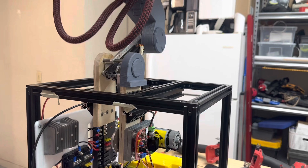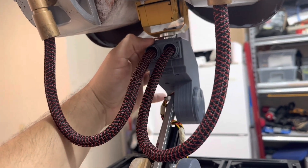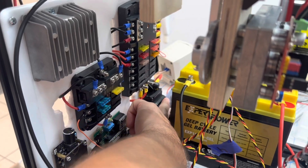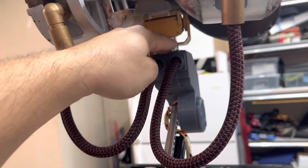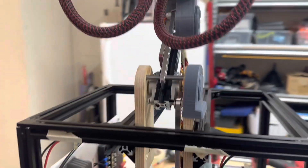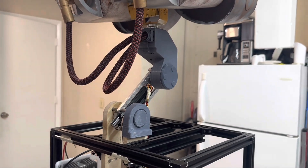One last cool feature: because I'm using this type of servo, I can obviously control it up and down. What's cool is it has stall power, so I can't push it down. But if I cut power — I'm just going to press the fuse so you can see my lights — the servo holds this position. I still can't push it down. So even when the power is cut, it holds the position and locks in place, which is super handy for when you're pushing or moving them around.